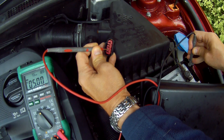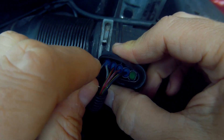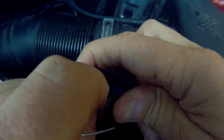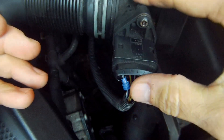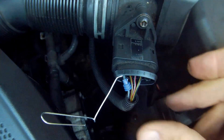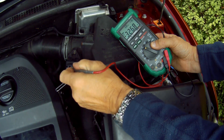As all these seem to be fine, I'll go on to now test the signal wire. Turn the ignition off. Remove the little blue plug in connection number five — you can do this with a sharp instrument like a paper clip, which we can actually use later. Reconnect the connector to the housing, then put the positive lead of the probe directly on the back of the signal wire, or insert a paper clip. Meter set to volts DC, positive lead on contact number five — the signal wire — and negative to ground.